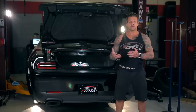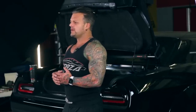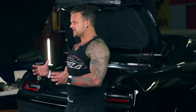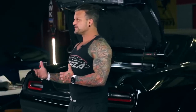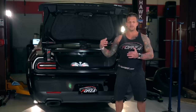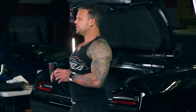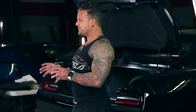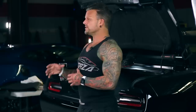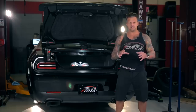Now I recommend it for a lot of cars. A lot of times guys will have a high-horsepower car and they're running on pump gas. If we get some good high-quality 93-octane pump gas — and I personally always recommend Shell specifically — through testing different fuels from all around the country, you can see that all 93-octane fuels are not created equal. You will see a drastic difference in the amount of timing the exact same combination can handle with different fuels from different gas stations.